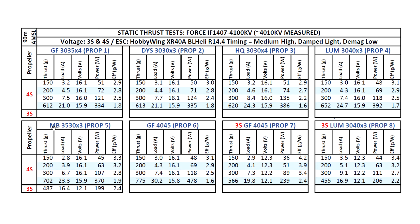The Militia Brothers 3.5-inch tri-blade also did pretty okay on 3S — it's not going to be super fast, but it's a good option if you want to run a 3.5-inch prop. Overall, pretty good performance out of this motor. The thrust results are pretty comparable to other motors of this size and kV. Hope you find the test useful. We've got more thrust tests coming up — stay tuned, and thanks for watching.